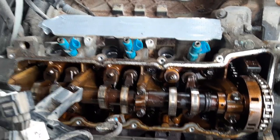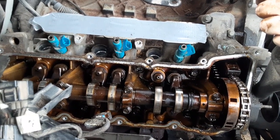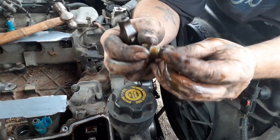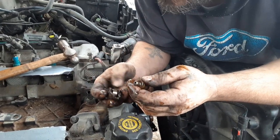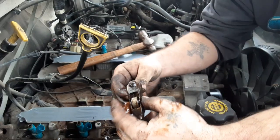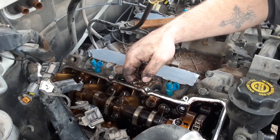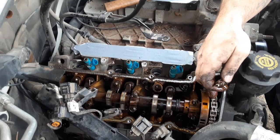Could water getting down in the cylinder and putting too much pressure on it when trying to start — could that have thrown that lifter off there? Maybe. There's water in there too, as you can see — it's milky. It didn't bend the cam. This sets underneath the cam and when it comes up it pushes down on that valve. Maybe the water pressure just threw it off — either way the head's going to have to come off to check for a head gasket leak.